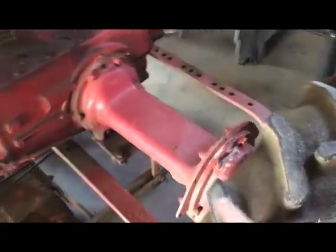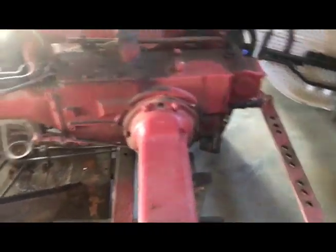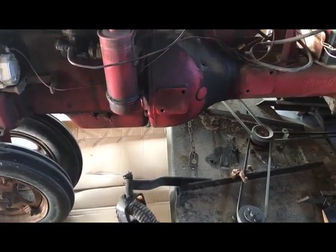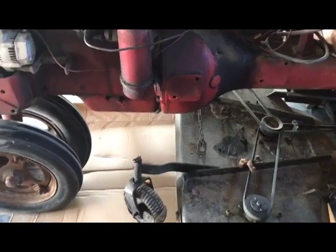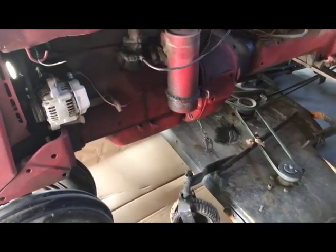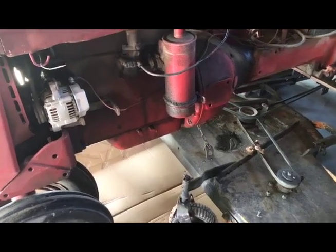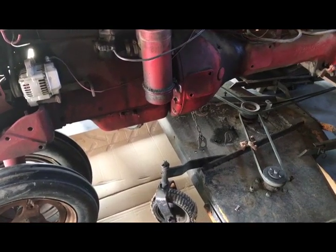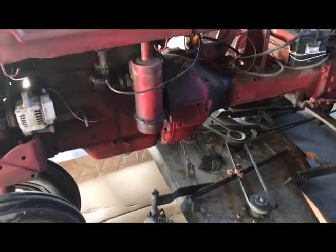The fenders are still off — I'm still pecking at that. Every time I get it where I think I'm happy with it, I look at it again and say no, we'll do something else. If you know anything about rolling these bearings, the service manual gives the directions on it and I've seen it done in YouTube videos — not yet on a Farmall, but all kinds of things. Let me know in the comments, I'd be happy to hear your experience. I go to church with a guy who retired from an engine shop and he says go for it rolling them in unless it's just awful in there — in that case you probably need to break it down, and obviously if the crank needs to be ground, get that done. We're going to give it a shot over the next couple weeks. Thanks for watching, we'll see you later.